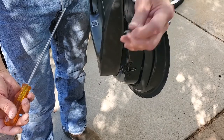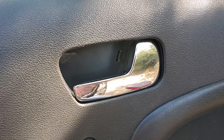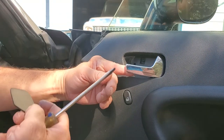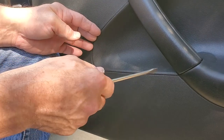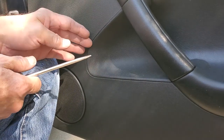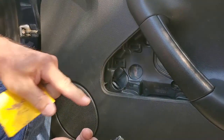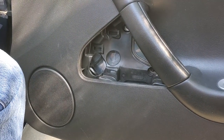I like to set the parts in the car so I don't lose them. Inside the area behind your interior door handle, you have a little panel with a tab. You've got to pop the tab out and get your little plastic piece to come out of there. We're doing that because there's another fastener behind that point. Down here you have another panel that needs to come out. I'm going to grab an old plastic spreader for body filler, insert it in there, and pop this panel — that way I don't damage either part.